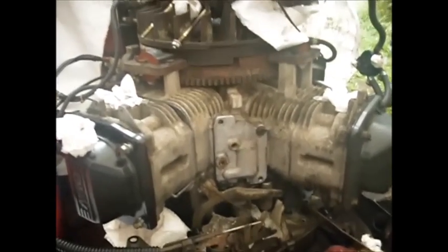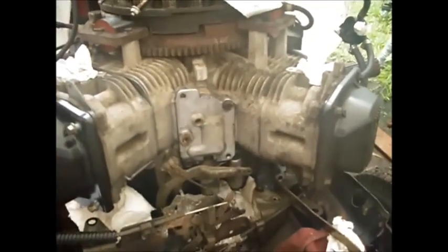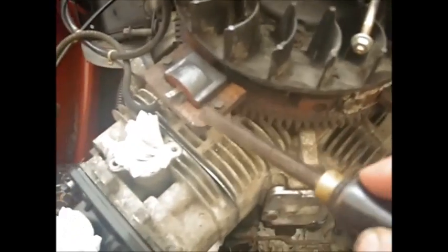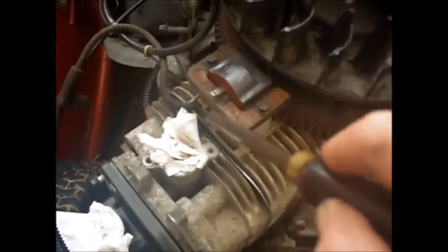I'm gonna rotate it and then let it set for ten minutes. After that, I'm gonna break into the other cylinder on this side - I cleaned it off a little bit - and do the same thing. Afterwards, when I get it all sealed back up, I'm gonna clean up these magneto parts a little bit, scrape some of the rust off. It looks like a little crack in the wire, so I might just wrap that up since it seemed like it was firing okay.